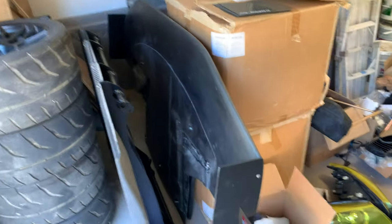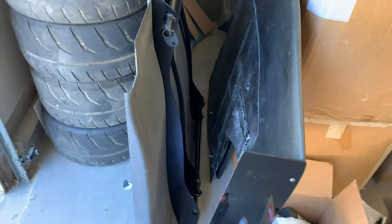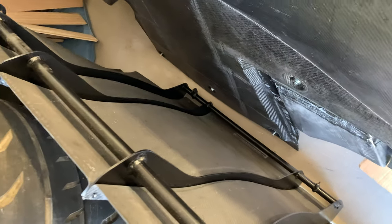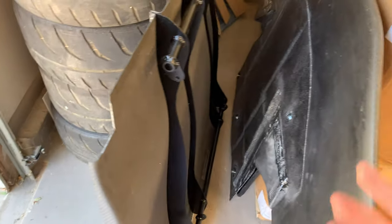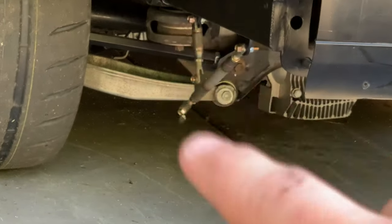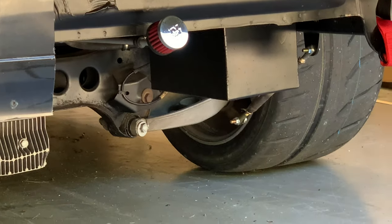This is the enormous Klaus composite carbon fiber splitter. And then we have the AJ Hartman modular carbon fiber rear diffuser. It's been trimmed to fit the wheels in the back with the added wheel width. E-Fab also fabricated an entire, kind of elaborate and awesome aluminum mounting solution here. Normally when you get it from AJ Hartman it's just all the carbon fiber put together — there's not really a mounting system. So E-Fab fabricated all the mounting hardware, and all of that will actually connect right to those mounting points there. There's a mounting piece on the other side of the battery box, and there are a couple of mounting points right up inside the back of the bumper.